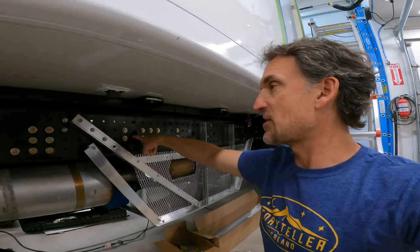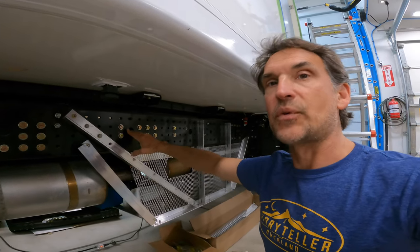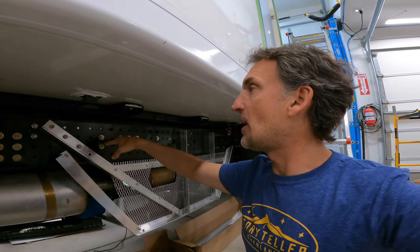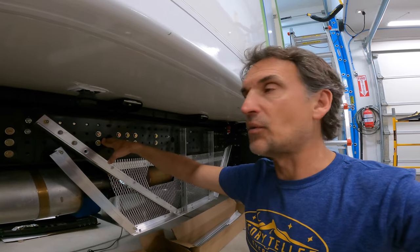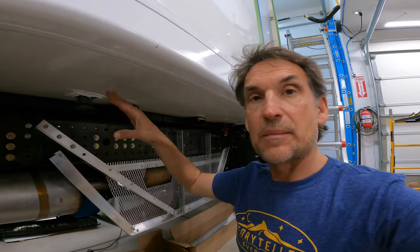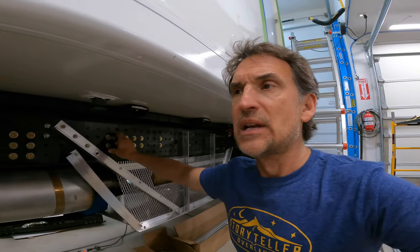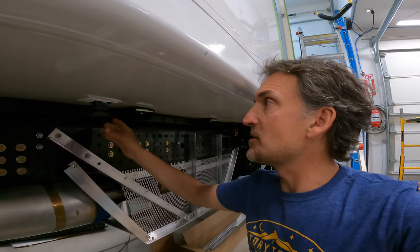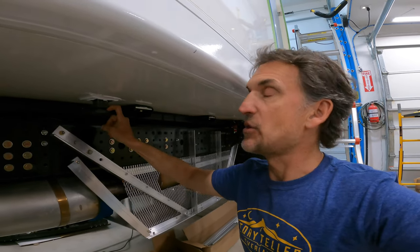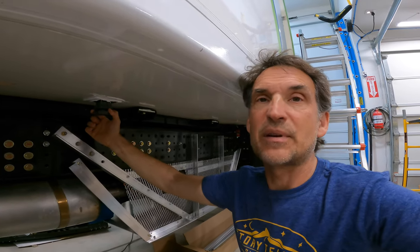It's a really wonderful attachment point. And it's near the muffler, so it'll actually stay warm through wintertime and probably won't freeze up. But even if it did, it's below the van — any hot water coming down through here will melt it away. And at least this way it's got a lot of headroom before water can back up into the camper should there be a freeze below. It's completely watertight and sealed before it would back up into a sink above — it's got about four feet of vertical height before it would do that.